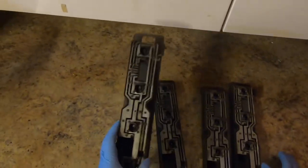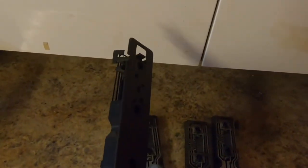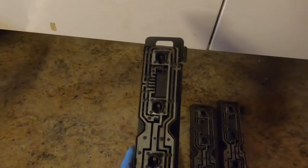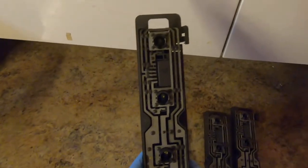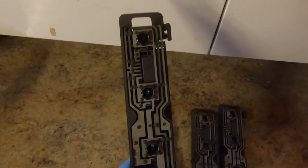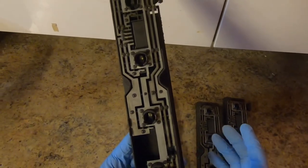But when these things actually happen, it's kind of confusing because it looks like a brake light switch, and it can be. When the brake light switch goes, it's basically located underneath your brake pedal. It's a little black piece. I don't have it with me right here. When it goes, it's like a $20 component. You can't shift your shifter and stuff like that. But this will trip it just as well, and you'll be having issues trying to find out what's going on.